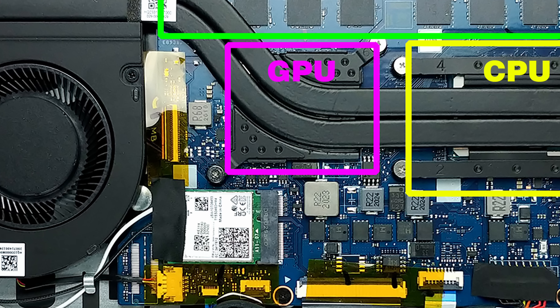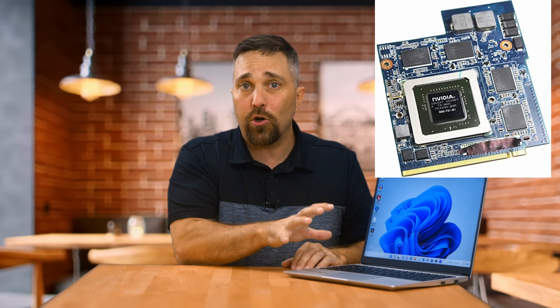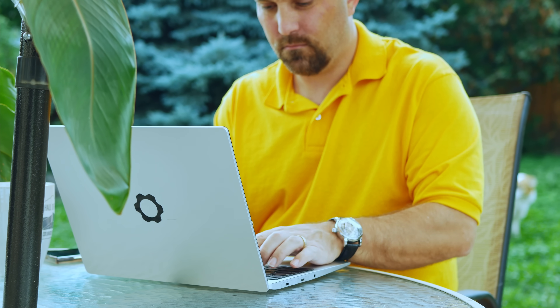Dedicated graphics doesn't really work in this concept — laptops in this form factor with dedicated graphics, like the Acer Swift X, have the GPU soldered directly to the motherboard for reasons of power efficiency, cooling support, and thinness. Upgrading then becomes significantly more difficult and expensive, requiring replacement of the GPU, CPU, and motherboard as a unit. Adding a GPU on a daughter board increases height, requires a second fan for independent cooling, and significantly increases power demand, pushing you past the ultralight form factor into something like an HP Omen. I think Framework may get there — this is their proof of concept, which is a great product and happened to be exactly what I was looking for. If it's something you're looking for, the Framework link is in the description below. Be sure to like and subscribe, leave a comment, and let me know what you think of the Framework.